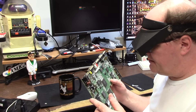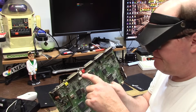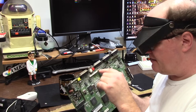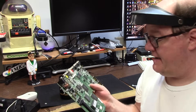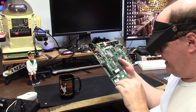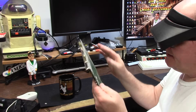For the 600 I like to remove the audio connectors to have better access. Can't get in there with two soldering irons or hot tweezers without melting the keyboard ribbon, so we're not going to do that — I do it my way. This is kickstart 3.2.1 on a 1.5, big sticker. And that's all I can tell you on this.